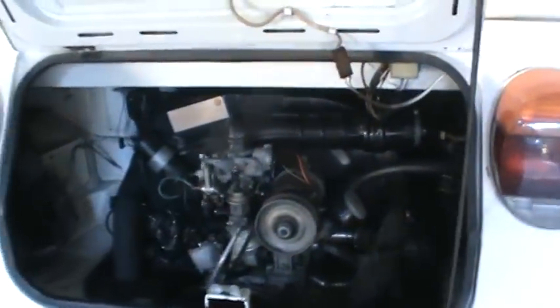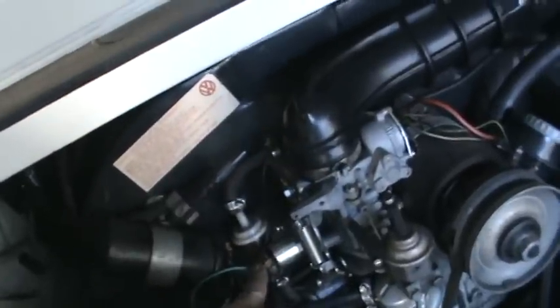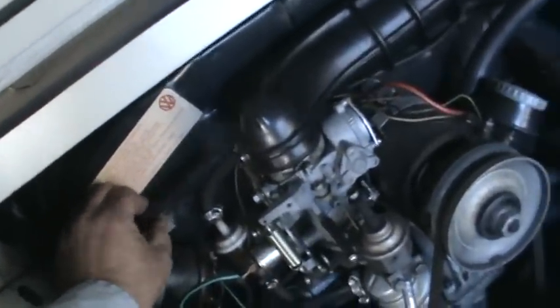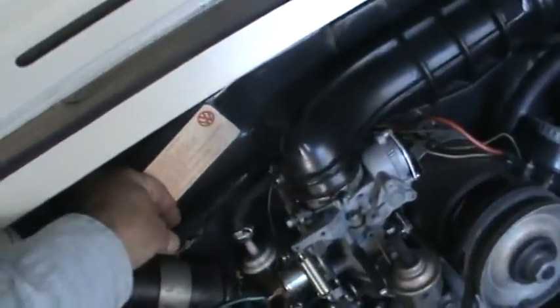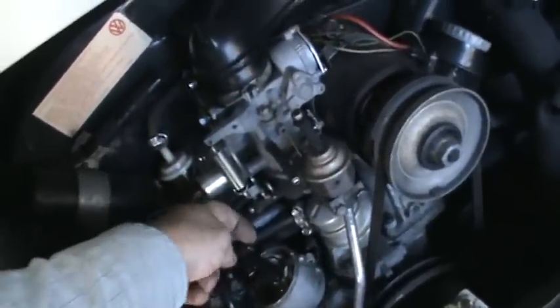That about covers this thing — front and back. We went over the motor, the shocks, the transmission. We checked for a tune-up, checked the carburetor out. The fuel filter is very dirty and shouldn't be this close to the ignition components and power sources — I'd like to run the filter up over here. This is your reverse light wiring harness — we need to see why that's not working, and also eliminate some of this rubber fuel line and replace it with German hose.